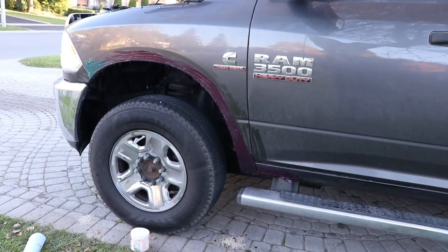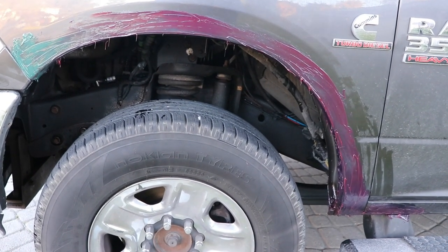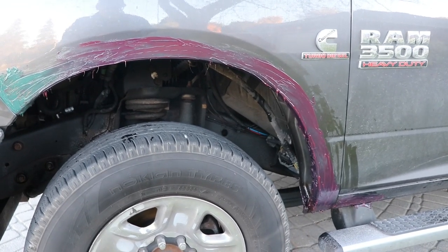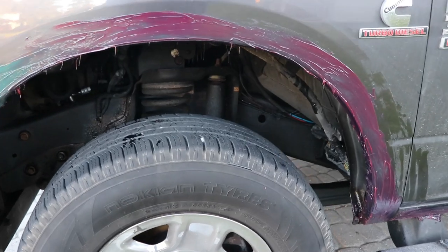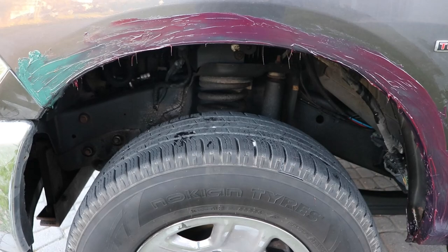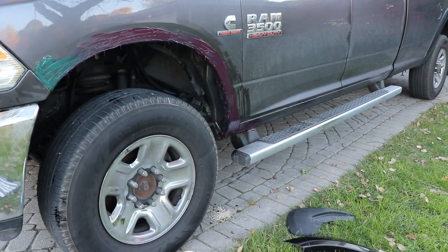We've got the grease on the fenders. Unfortunately, this is the way it's got to be in Canada — you get everything undercoated as best you can, then slap on as much grease as you can. Fluid Film is a decent spray, but I find it freezes — you can't spray it when it's cold. Rust Check, which is a red fluid, is a thinner film that creeps well and works good for spraying in the frame. I used an air compressor to blow out the frame before squirting some into the available openings. I parked and undercoated and made quite a mess of the road in just one evening.